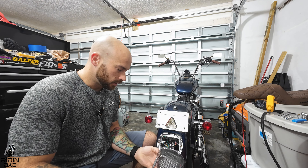Make sure when you are screwing these in, don't over-tighten. If you over-tighten it, you can crack this bezel. Whether you have chrome or black, this bezel is plastic, and obviously your taillight — whether stock or not — is plastic as well, so it's something you want to be careful about. Make sure you've aligned it correctly, because there's going to be a little lip for that light that should fit into the bezel. There we go, now it's in.